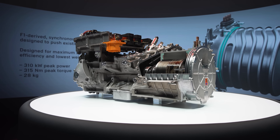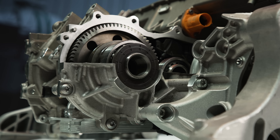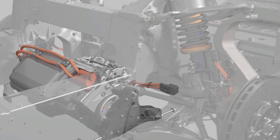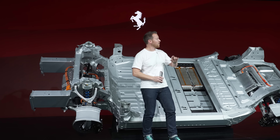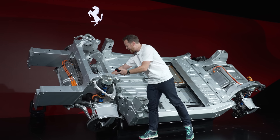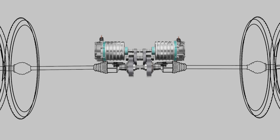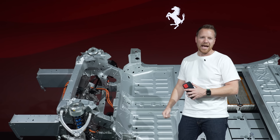It's not quite as simple as just adding the axles up, but Ferrari claims over a thousand horsepower in total, as well as an absurd 8,000 Newton metres of torque from the rear axle alone and another 3,500 Newton metres from the front. The front motors can spin up to 30,000 RPM and the rear ones up to 25,500 RPM. There's also a clever disconnector so you can switch between all-wheel drive and rear-wheel drive — not really for big silly skids, but more to do with efficiency, so at highway speeds you can decouple the front axle and get maximum range from your batteries.